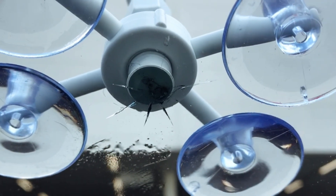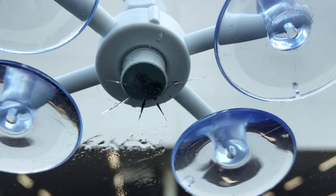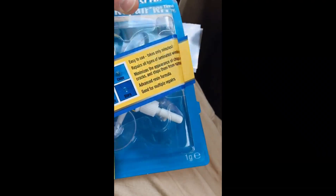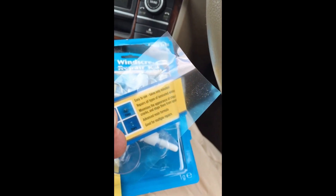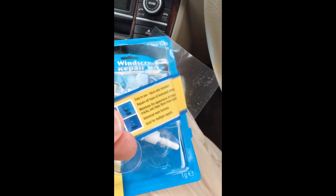There it is from the inside. That resin's just running into the cracks now. I've got the pressure on with that plastic bolt screwed down. A few minutes have passed — I've removed the suction pads and taken the pressure off with the plastic bolt. I've just placed over it one of these plastic curing strips. It just stays there — it doesn't stick, it just places on top. And then I need to park the car in either warm or direct sunlight and leave it to set properly for another five or six minutes.